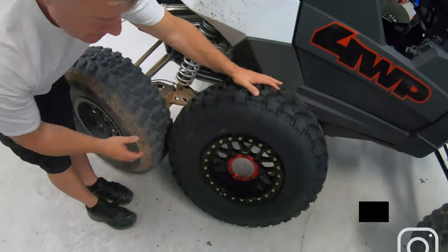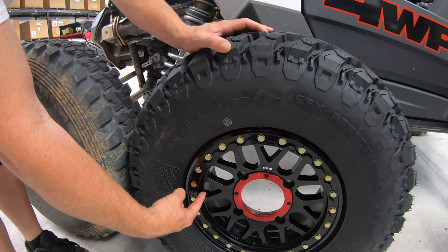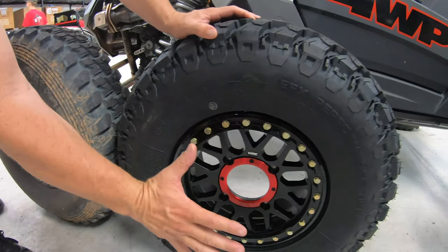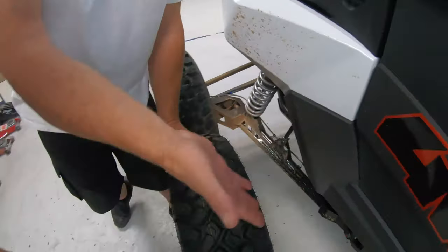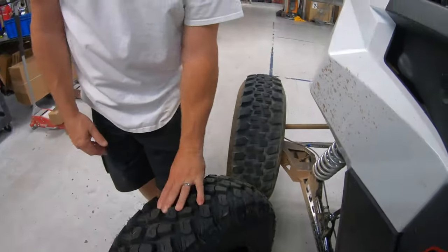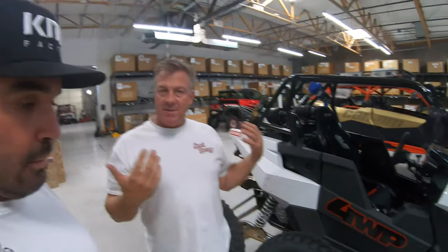The KMC wheel has a much more shallow outside distance. This tells you there's a lot less outside distance than the stock wheel. Way more shallow — which means the whole wheel is pushed inboard. This is a 5-2 offset instead of a 4-3: five inches to the inside, two to the outside. Way more distance on the inside of the spindle, the hub, the drive flange in the front, and less on the outside — which decreases leverage and makes the car drive perfectly straight with less feedback in the wheel.